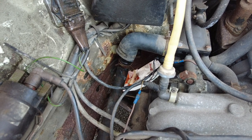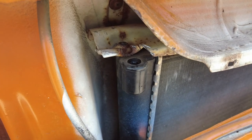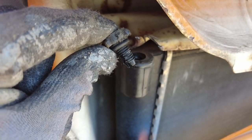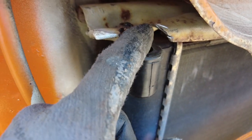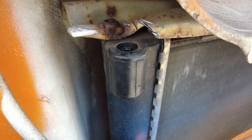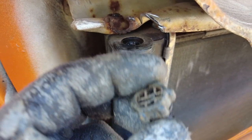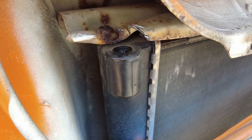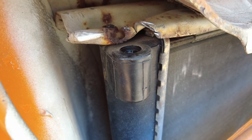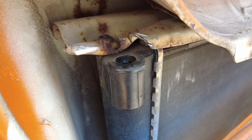So it's quite important to use decent coolant with a pink glycol to stop any rust. Basically, don't trust what people tell you because clearly it wasn't all the truth. I also know for a fact he never bled the system, because the little cap on this radiator — which does look new, looks like it's been replaced — wouldn't come out because the metalwork here was in the way. I had to use a hacksaw to cut it just to take that out. There's absolutely no way he'd had that out to bleed it. So quite scarily, I'd driven back from York to Sheffield, about 50 odd miles, with a coolant temperature gauge that was quite low on the needle and I suspect that's why.